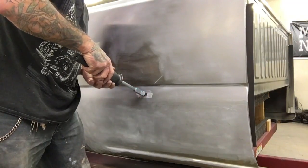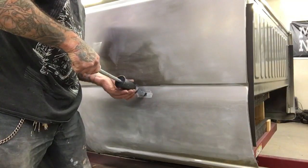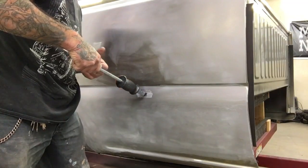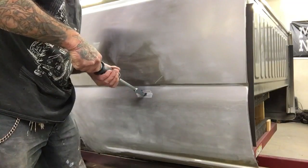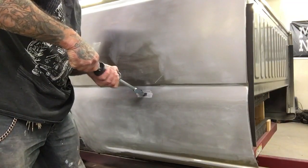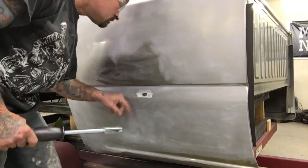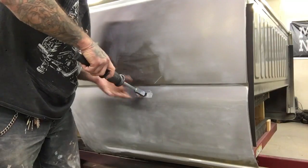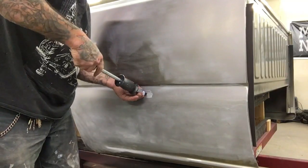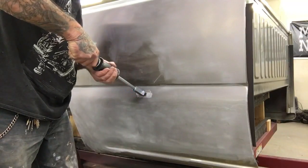You're going to use your slide hammer — you want to keep pressure on this too when you're doing this. Take your weight on the slide hammer and pull it back until it slams into here. You don't want to do it real hard. I'm going to do a little bit more. I don't know about this toggle on here — I'm not too thrilled about that right now, because if it's going to let go that easy, that's not good.